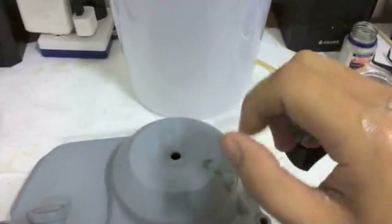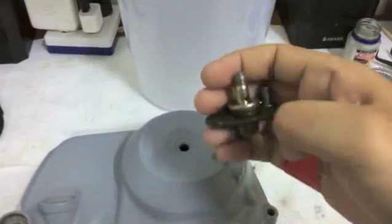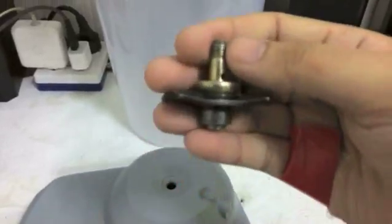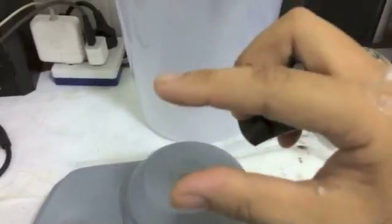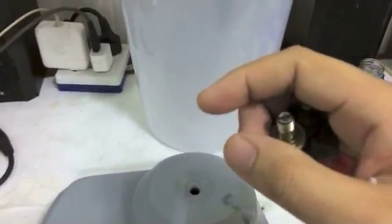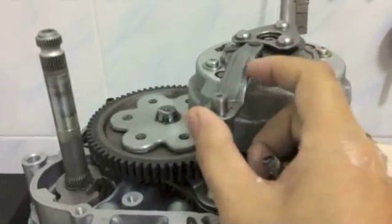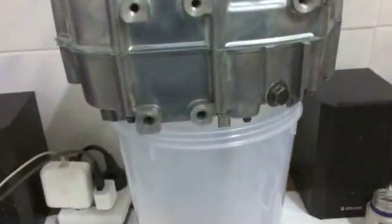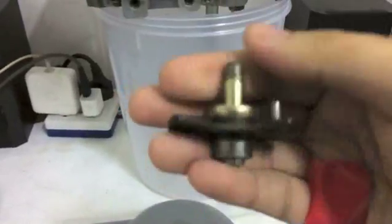more and more, you have to tighten the brake spring so that the brakes will still contact the inside of the drum. And it's similar to this: when the clutch starts to wear out more and more, it's going to shrink. And so the distance between contacting the clutch with the arm and pushing down so that it disengages is going to be greater, and so you need something to take up the slack. And that's what this bit is.